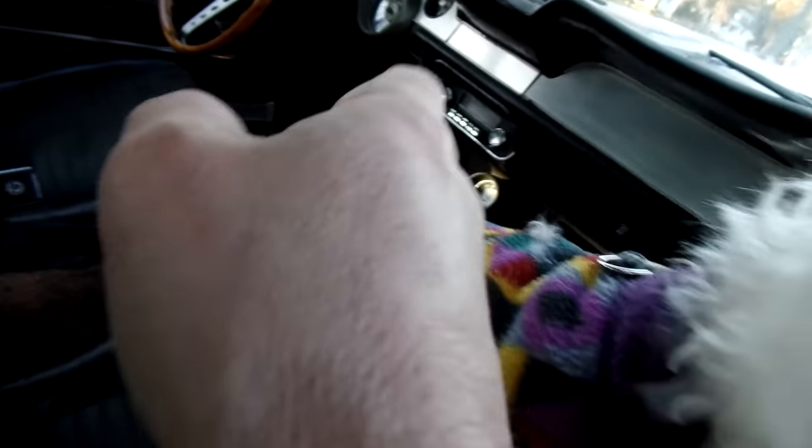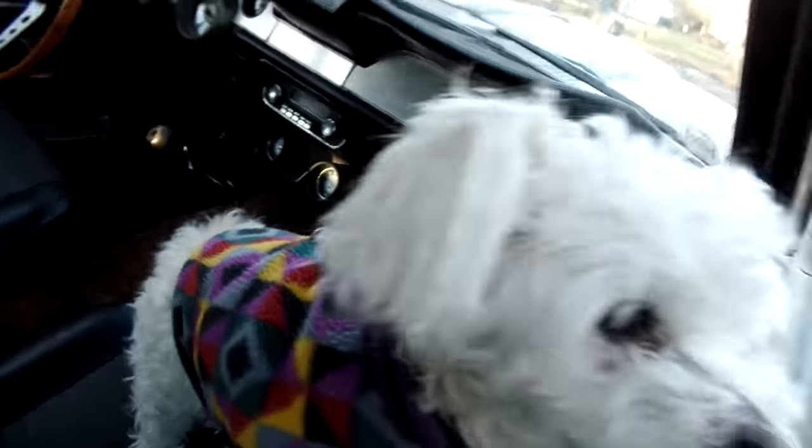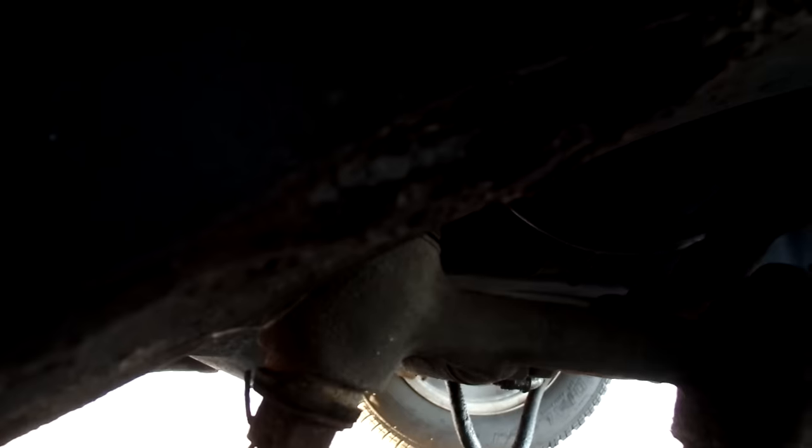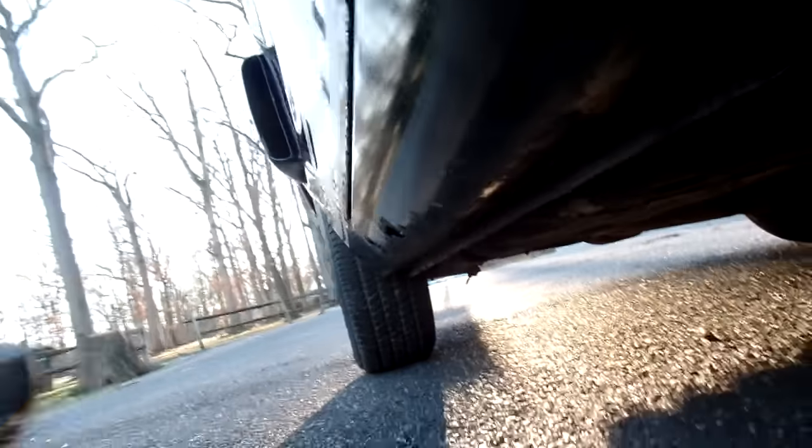This wheel lip looks pretty good — a little bit of noise there but pretty good. The quarters are fine. The floors are pretty good in the back — there might be a little rust; I have a picture of that on the auction. The front is pretty bad up there by the pedals. The torque box on that side is just really messed up, and this side has a hole too up front. You can see right there — the frame rails up front have just a little spot here and there that needs to be cleaned up. The floors actually aren't too bad. There's that pinch weld where that rust is on the outer rocker.